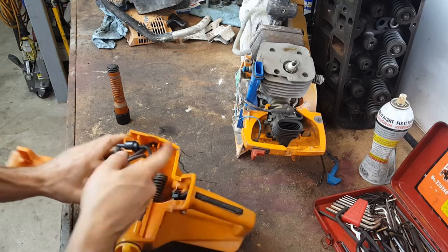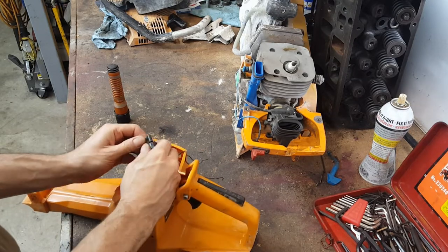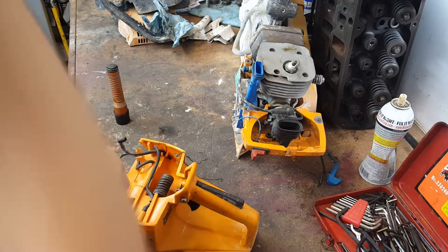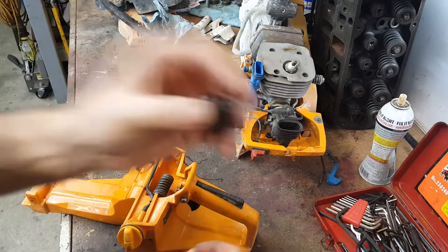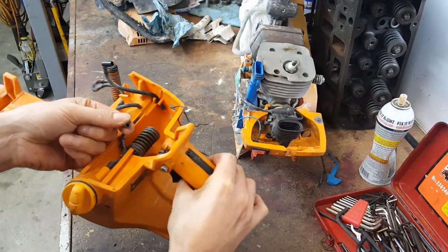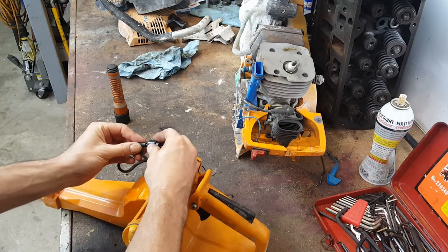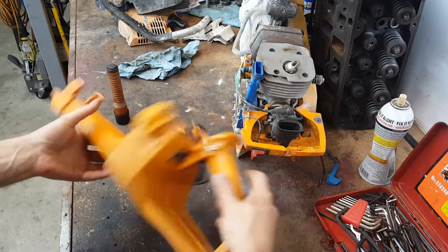Maybe the fuel leaked out of here — this is some kind of an overflow, there's a small hole inside here. This looks like it's a check valve: no air going this way, but restricted air going this way. I can actually build up pressure. So the tank is pretty much sealed up. Looks like there's flow through the fuel filter, so let's put this back together and give the tank a pass for now.